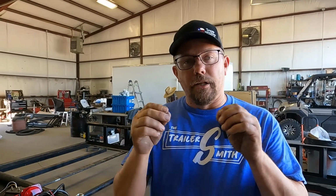Speaking of overheating, one way to find a ground wire issue is, if you were having an issue, plug that in, turn on your headlights, whatever you may have, go around and start feeling your wiring. Always feel the grounds first, if you have a chassis ground or even a butt connector. If it's warm or if it's hot, then it's struggling to make that connection. They should really never be warm.